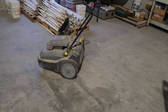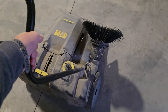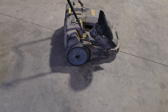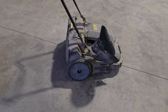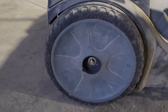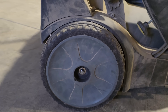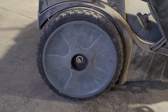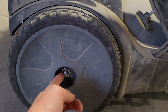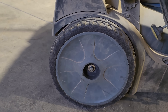Oh yeah, then there's this. I did kind of sort of fix it. If you remember this from a couple of weeks ago, this tire here likes to fall off because the snap ring groove was bad, so it would just push out. I got lots of suggestions on how to fix it — some were practical or would potentially work, some would not. Probably the most common suggestion was to drill a hole and put a cotter pin in, and that's probably what we'll do if we still have trouble. The problem is it's in a recessed hole, so you can't get a real big cotter pin in there — it would have to be a pretty small one to fit just right, which is why they use the snap ring.